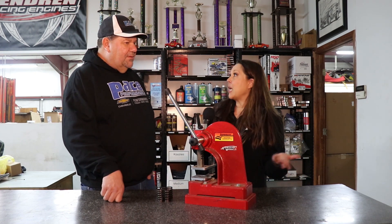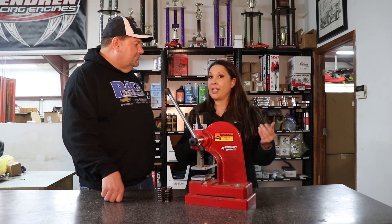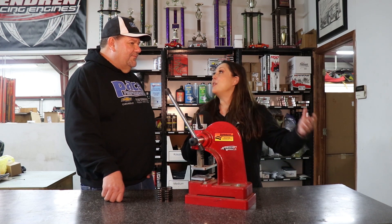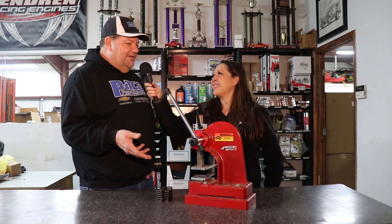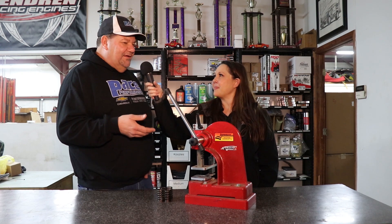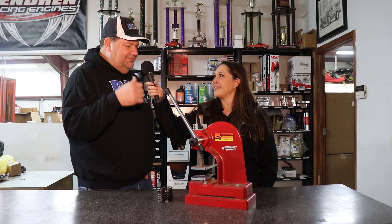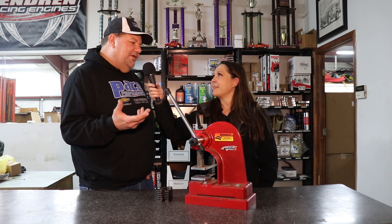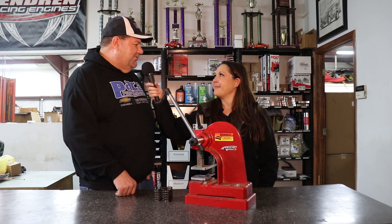That's not a number we typically publish because it's meaningless to anyone outside of this conversation. But on the engine dyno — and you also have access to a chassis dyno — how much difference is there between a matched set of 76s versus a matched set of 81s? Are you going to go from zero to hero? Absolutely not. I've done dyno testing on engines I've personally maintained and documented from day one. We just ran one that had 25 nights on it, ran the engine on the dyno, then changed the springs — went from a 74-pound seat pressure spring to a set of 81-pound springs — and made the exact same torque and horsepower as with the lighter spring. There are a lot of guys that talk about that a lot, but I look at mid-lift and over-the-nose numbers for valve springs.